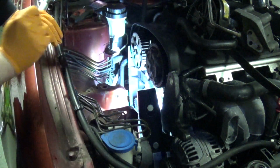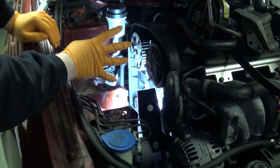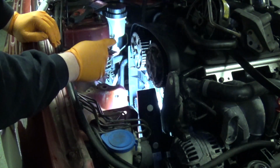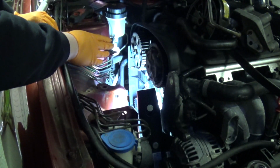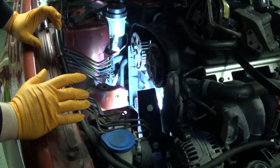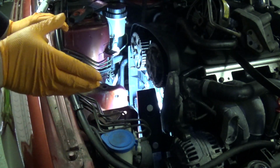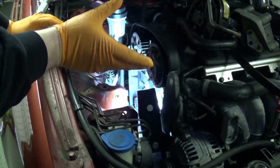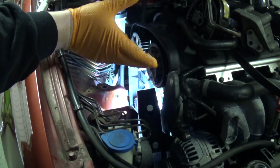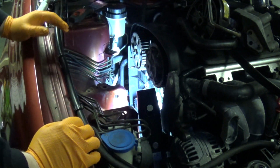Okay, as I hope you saw there, I put the gasket onto the block, and what I did is the bottom left and sort of top left, top centre, there's 2 mounting pegs. If you fit the pump onto the lower peg with the gasket already in place, you can then sort of lever the top inward slightly, just wiggle that slightly and that just slotted onto the other peg.